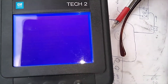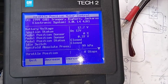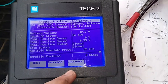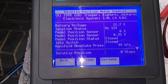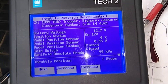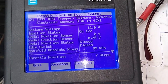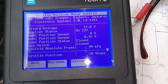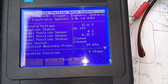We'll go down there and we're in business. In here we can increase and decrease the opening. We'll look down the neck — I'm going to push the increase button and you'll notice the steps in the bottom right-hand corner. Step nine, as I was showing in my previous video, is the position this sits in at idle, and during partial loads it opens up progressively.